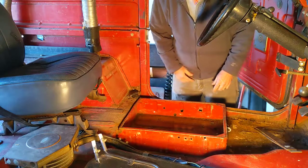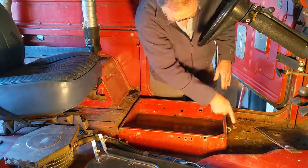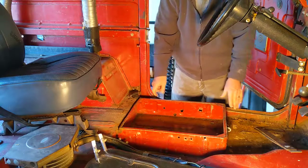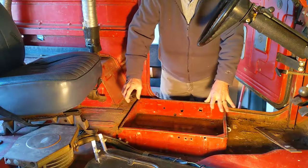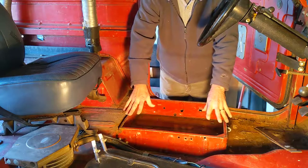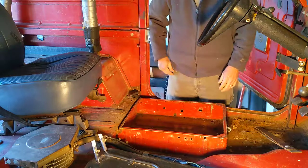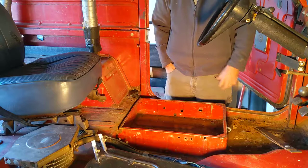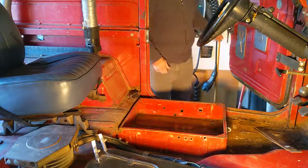What I'm actually thinking about doing is removing the toolbox — it's spot-welded on around here — and then building out a set of mounts for the seat, welding them up, and getting them bolted down to the floor of the truck securely at the right height. That would let me stick with the aftermarket seats. That's what I'm trying to work out today. Thanks for watching.